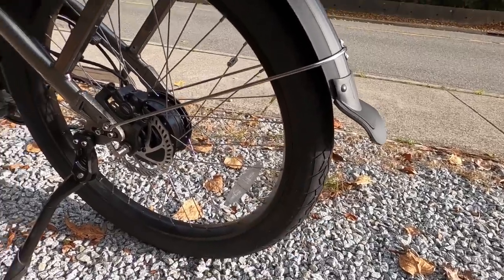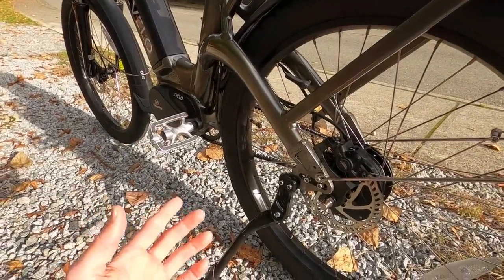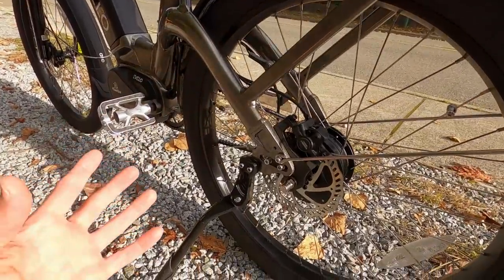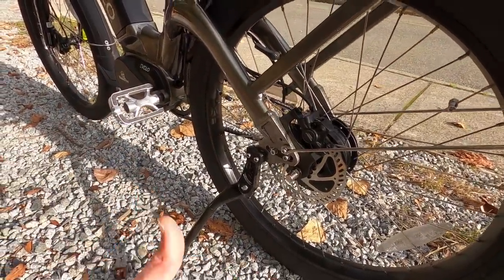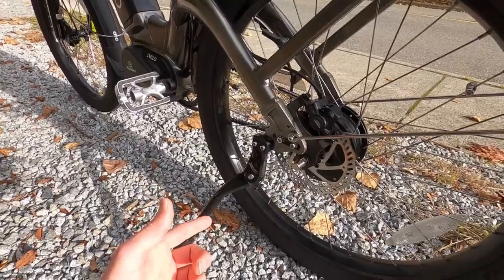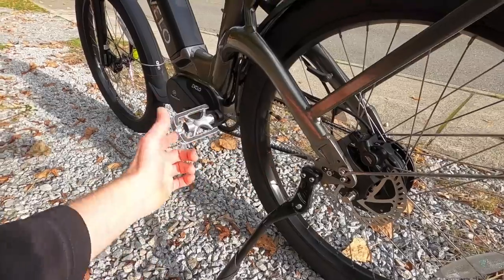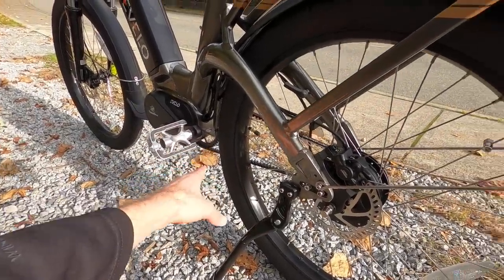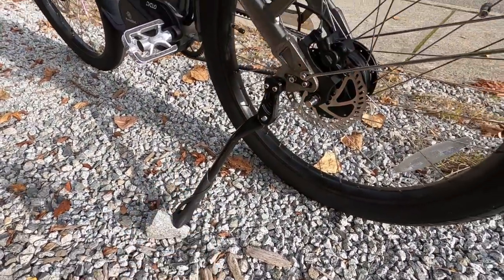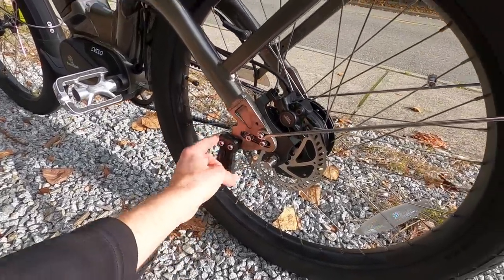These are custom-made Inova tires — 26 by 2.8 with puncture protection, custom made for Evelo. The PSI rating is like 20 to 45, so it's actually pretty low pressure, which comes back to comfort. These aren't way up at 60 or 80, where it's just like a rock. I love what they've done with the kickstand too — you'll notice it's very clear of the left crank arm, so you're not gonna get pedal lock. It's not right in the center of the bike. It's going to support the rear rack if you've got it loaded, it is adjustable length. Just well done — they customized this tab and made space for this.